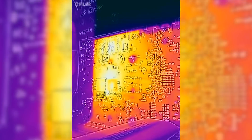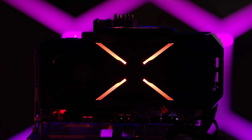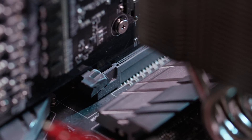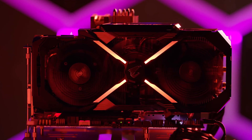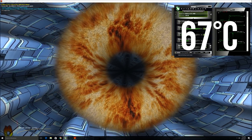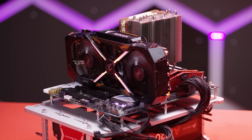We even took some shots with our FLIR thermal camera to give you guys a more complete picture of what's going on. The Founders Edition backplate didn't really help anything. But a challenger approaches — aggressive angles, animalistic symbols, refined copper metal, and industrial styling. Same process: slot it in, lock it in place, screw it in, crank the thermal and power limit to max, overclock the core and memory by 100 megahertz each, apply the fuzzy donut, and wait 20 minutes. Results: 67 degrees, and that's at over 2 gigahertz on the core. This is a pretty wicked card. It's fast, it runs cool — I hit a voltage limit at that overclock, but I'm liking it so far.